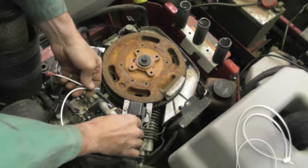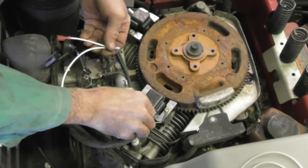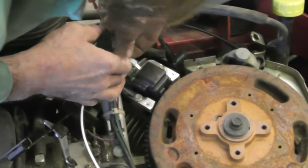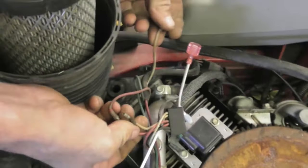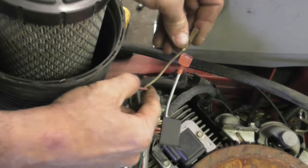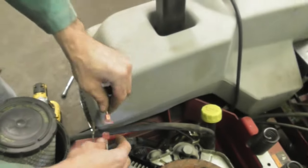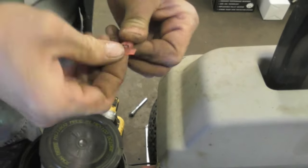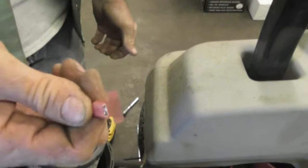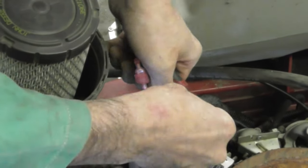Now our new kill wires. That's as far as that goes on, and this one goes on here. Then you hook it - here's the two wires. The power wire has got a bullet connector on it so we got to cut that off and crimp this on so it'll plug into there. Then break this off - I don't know what this stupid thing is on there. All right, now I got to cut that off. There we go - now that'll fit in there. Cut this off. White to white.